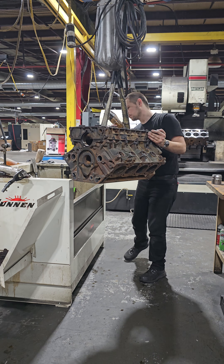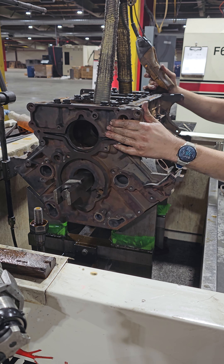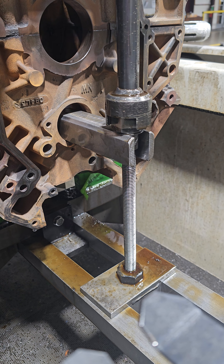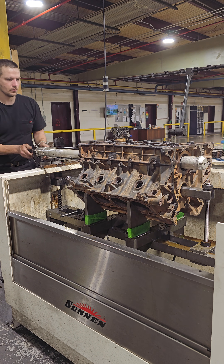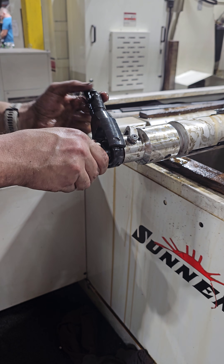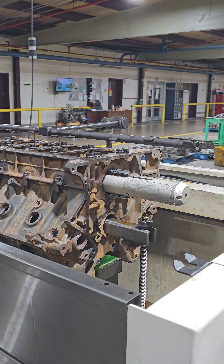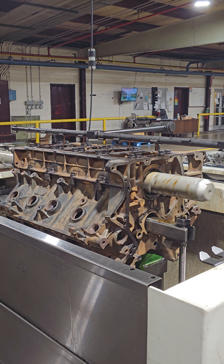So what I'm going to do is line hone it. You'll see me setting this up — I bring the engine in on my crane and put this bar in through the cam bearings, which helps me clamp down the engine while it's in the machine. Then I put the line hone itself, my stones, into it, bring my drill up to it, and make sure everything is even. In the footage you'll see everything is not even at all, so I had to compensate both vertically and at an angle side to side. I get it all nice and straight so I know I'm fixing something, not breaking it worse. That way we've got a good 6.0 to go out to a good Schott Engineering Performance customer.